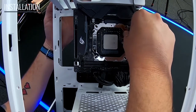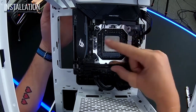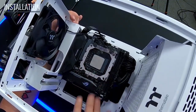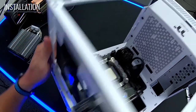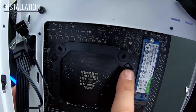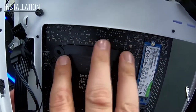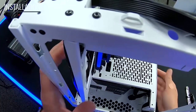Mount the four screw points on both sides of the cooler housing. Hand-tighten the thumb screws for a nice secure fit. On the back, make sure the screws stayed in their grooves all the way around — it's important for how everything matches up. This creates good tension pushing through from the back to secure the bracket on the front.